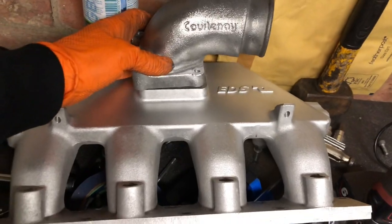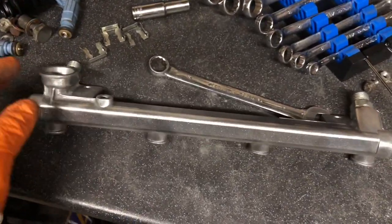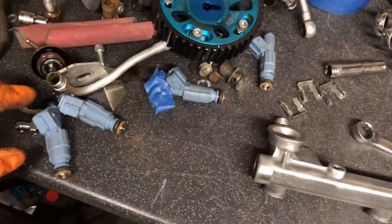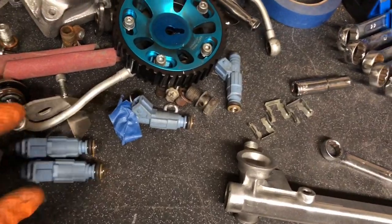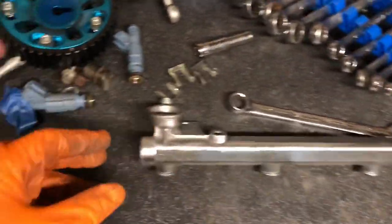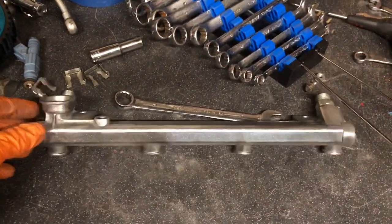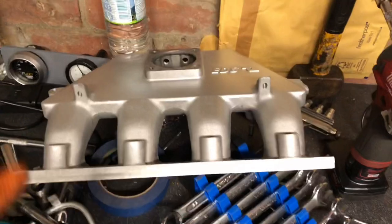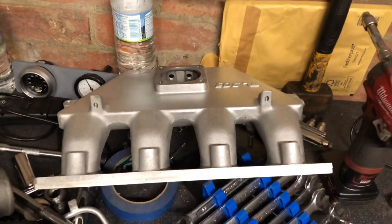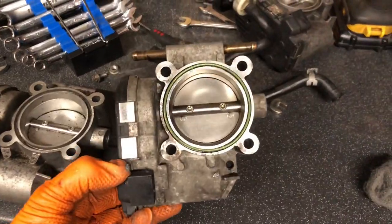It goes a little bit different against the EDS inlet manifold. I stripped down the fuel rail as well - these are from GM but they're aluminum and they corrode and oxidize because they have no coatings on them. These are brand new injectors, just stripped it down, put new copper washers in there, sealed it all up with new seals. I don't even trust GM to put things together properly, so we're going to build this inlet back up now with a new throttle body.